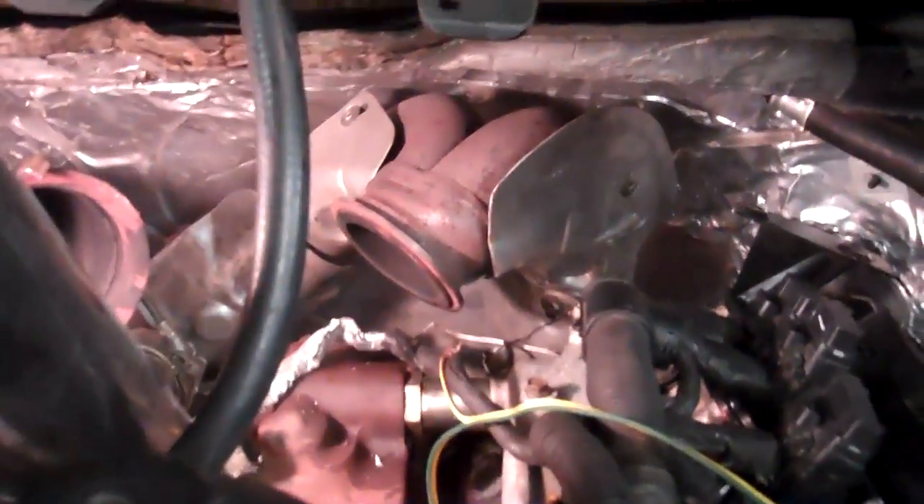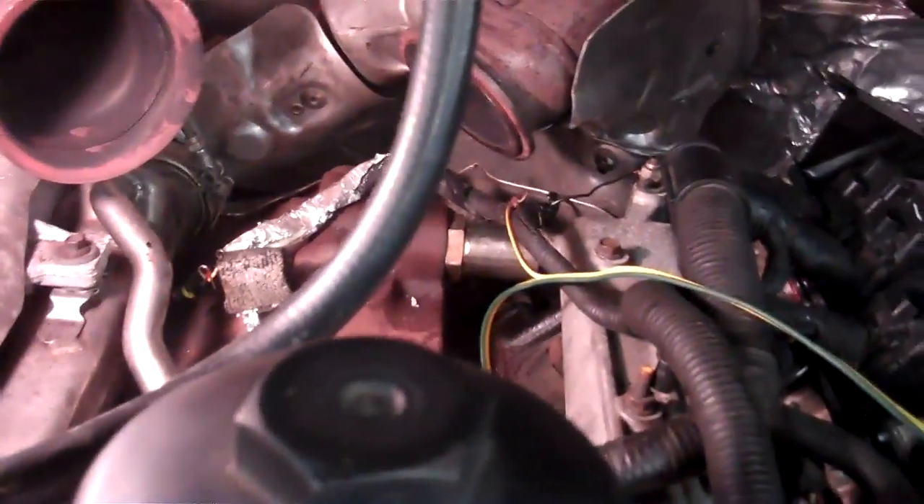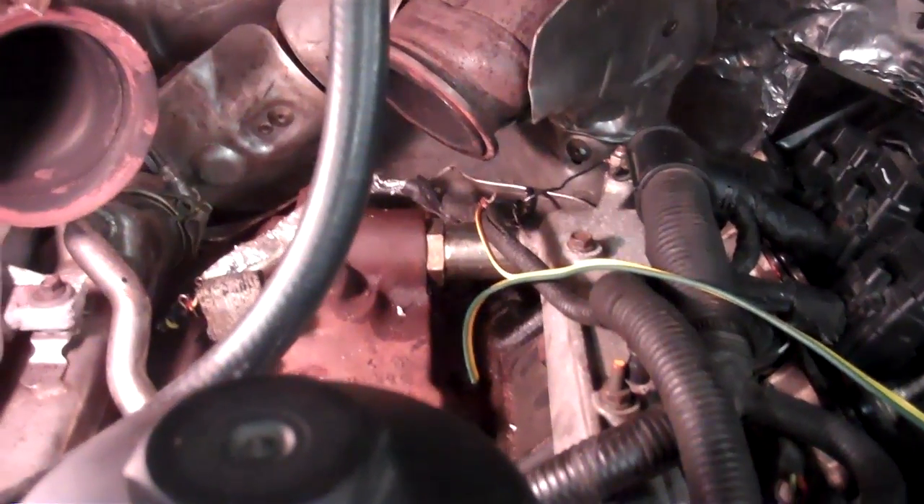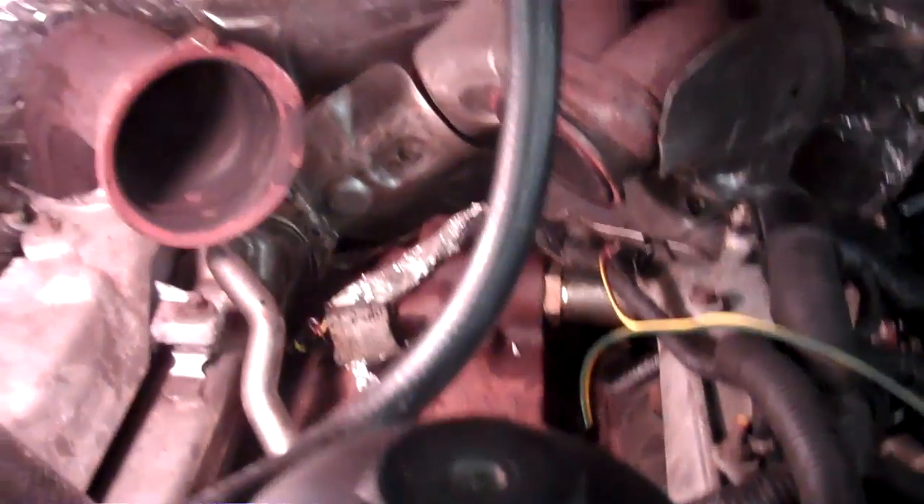It will crank when it's cold, but not when it's hot. I guess now it's time to pull the old intake manifold off and pull the HPOP cover and see if my suspicions are correct. Hopefully they are, or I'm going to waste a lot of time. That's how you air pressure test your HPO system on a 6-liter turbo diesel.